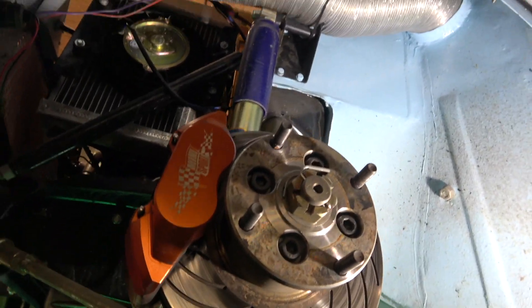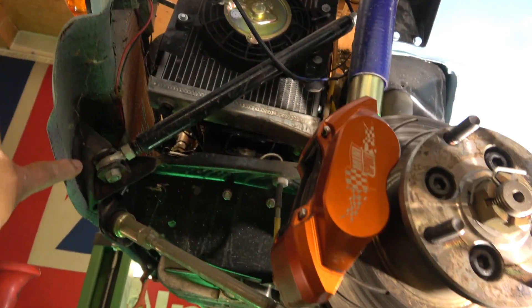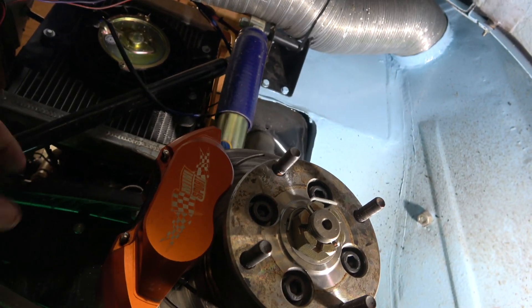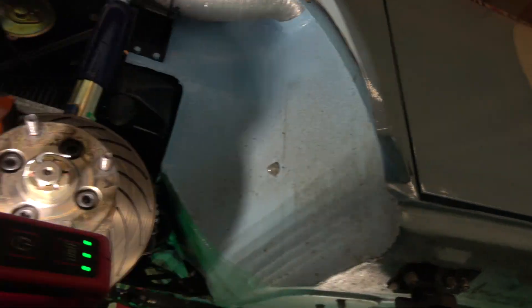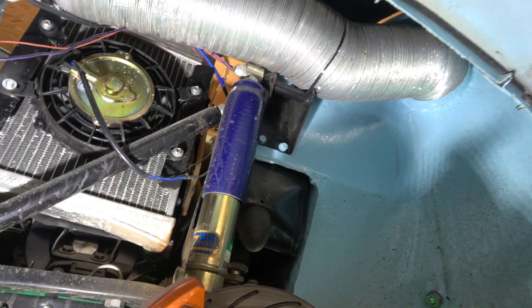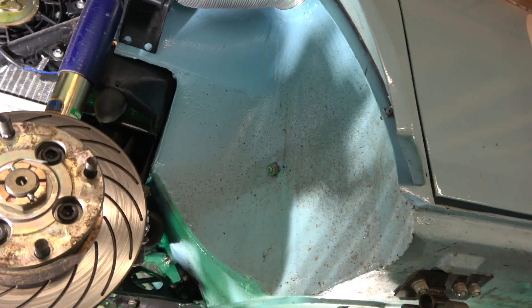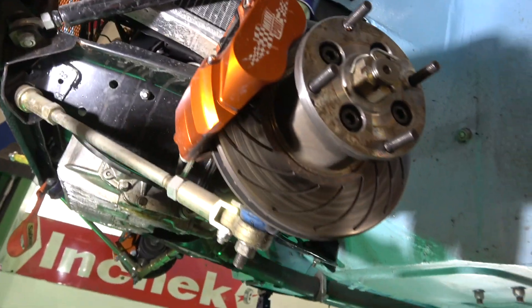The only real big difference - because this is a carbon fibre front - we've obviously had to put these rose joints on here, and we put these special connections on them so that when you twist the whole bar here, there's another rose joint at the top so you can twist that bar and bring the subframe tighter or looser or whatever you want to do. Everything on this is pretty much adjustable.